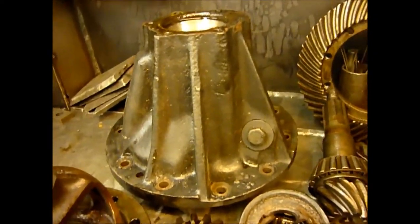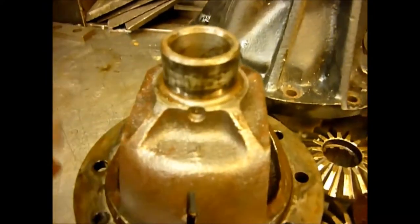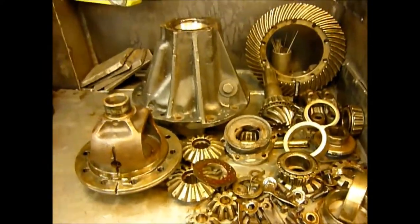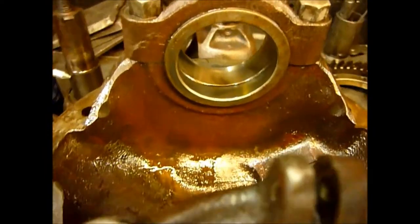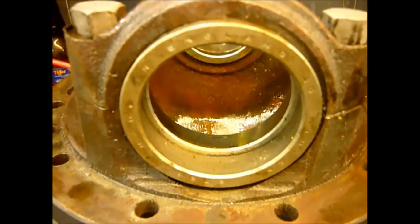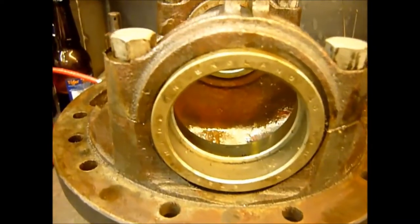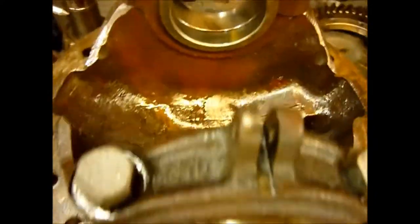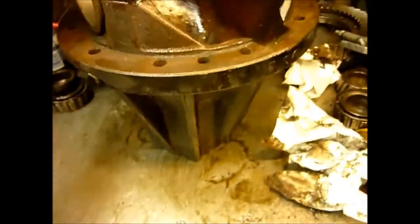Here's the oil seal, which has seen better days. The casing itself is going to be sent off for aqua blasting and cleaned up. Now these are colour painted — we're going to get the correct colour paint and recolour them. Basically, we're going to build the hell out of this so that it is one lovely original split casing diff. The oil ways are full of dirt. However, these are painted on the insides in a sort of weird pinky, red-y sort of colour, which we've got tins of. But when these were built, they were very much built in sort of 1940s-50s style of let's make them good and proper, and the bearings in here are all significantly bigger than the current Land Rover offering.